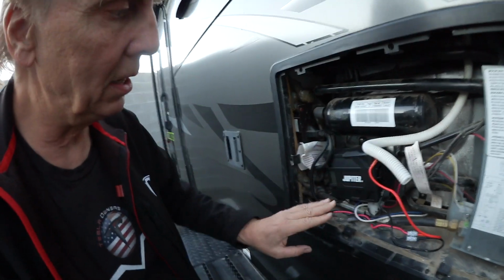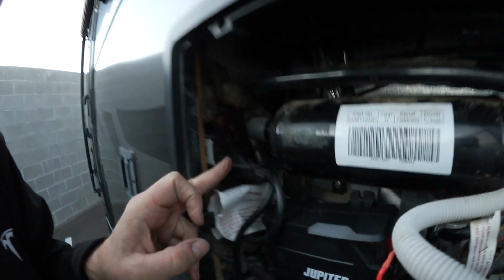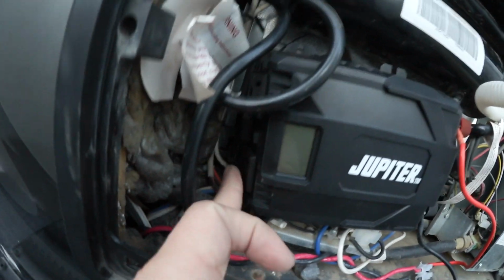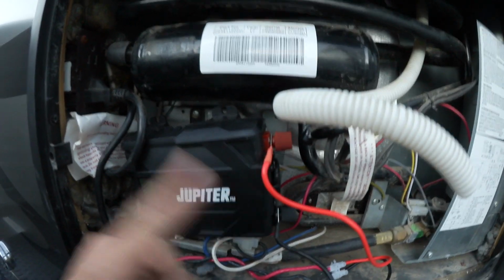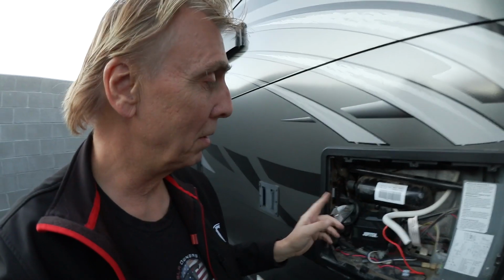And I inserted it in here, and then instead of putting it to here, I put that to here, and then it pulls the electricity from here, from an inverter, from 12 volts to 120 volt, and it consumes electricity there. And that's why I have also changed it, actually, even during driving, I don't burn gas anymore. Actually, I use the electricity in the 12 volt battery and from the photovoltaic. So while I'm driving, I can charge about 200 watt, I guess, and then there is a consumption of 150 watt on this one, and for 1 kilowatt, it's about a couple of hours.